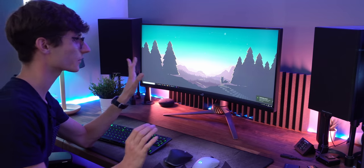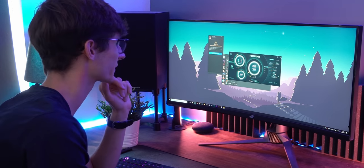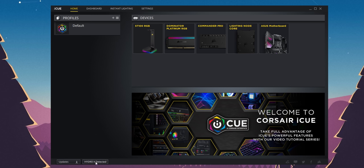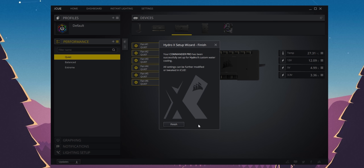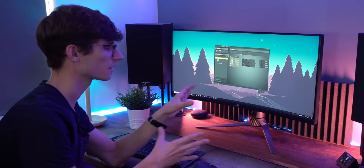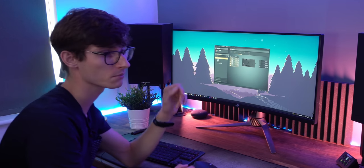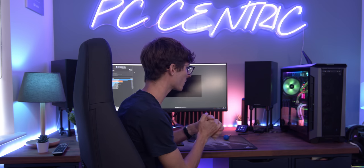It should say new CPU installed — yay, 10980XE! And the dog's come in again, he's definitely not allowed in the studio — he's excited. Does our computer work? It's just the graphics driver, it's okay. Our CPU is at a super toasty 33 degrees. As is always the case with Hydro X loops, you're going to want to go into iCUE, and then where it says Hydro X detected, run the wizard — and then the fans will automatically adjust to be super quiet, only spinning up when they need to. In theory the whole loop is taken care of, though I do like to make a few tweaks to pump speeds.